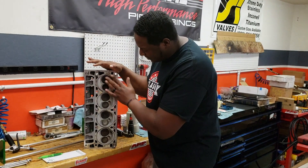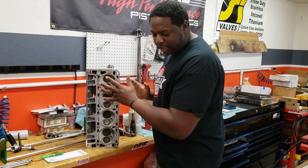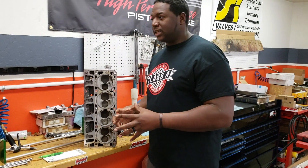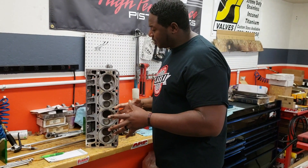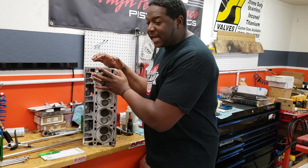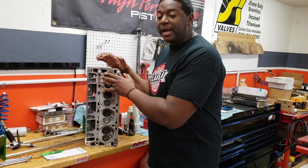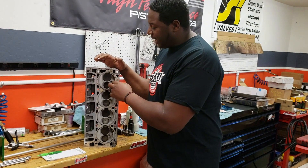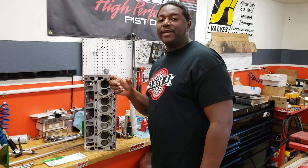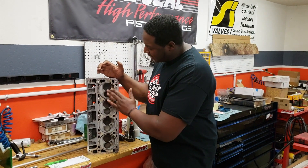Because if we cool this down first, it won't conduct heat down into my piston and get my piston hot. So therefore I can run a smaller ring pack. And it helps on my bearings. I don't have to run a heavier coated bearing because I really don't have a lot of heat there — because I'm taking all the heat out in the beginning.